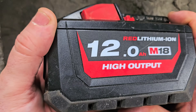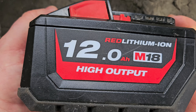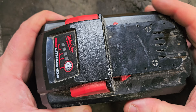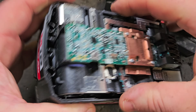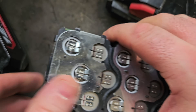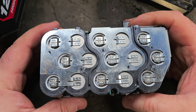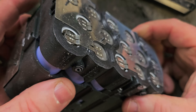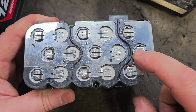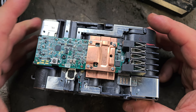I really like it. It's a powerhouse of a battery — it's been the go-to battery for years if you wanted long run time and high output for something that's a high power draw tool. It's got a fantastic robust casing inside and out; the cells are well protected in there and the outer casing is pretty strong also. In the engine room, as I call it, there are 15 Samsung 21700 40T cells in there, and they provided quite a lot of power.